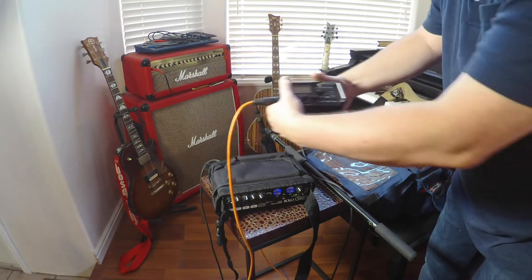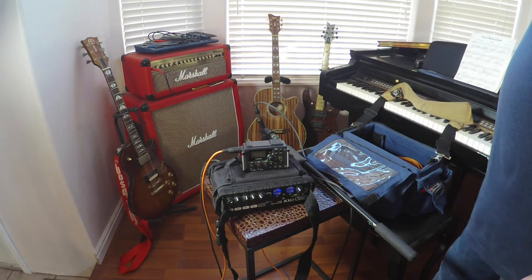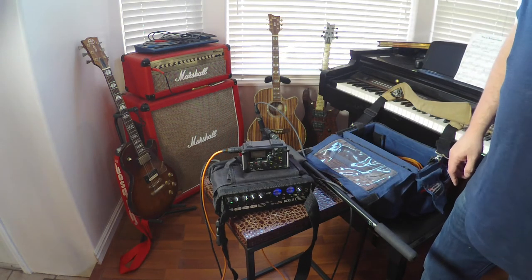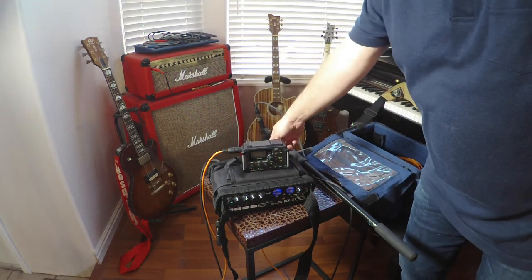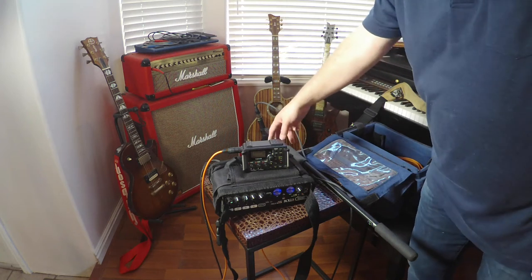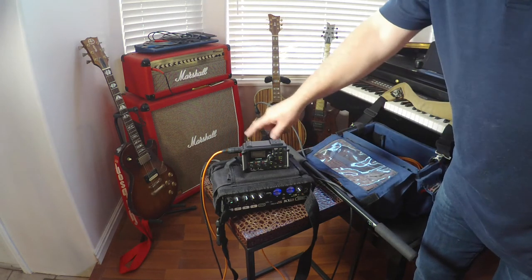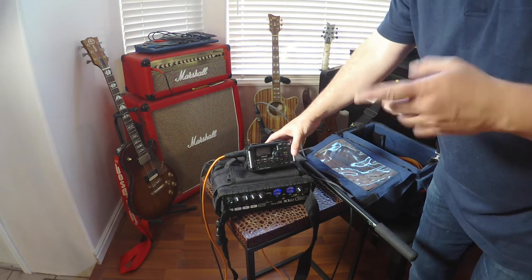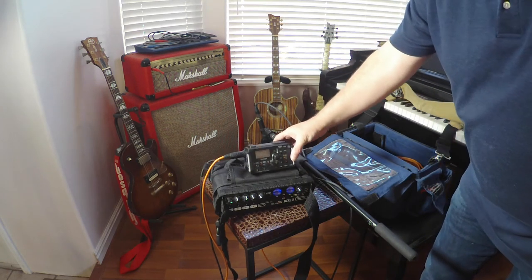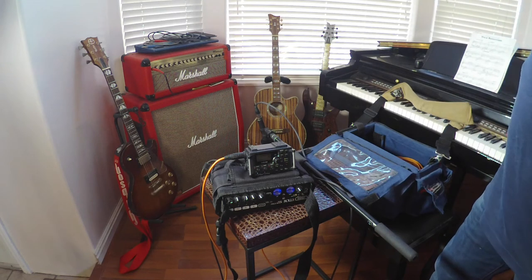That's the basic setup — a simple but very powerful audio setup. You can get really good audio with it. You have up to four inputs and up to two controllable outputs from the mixer, and two XLR inputs on the recorder. You usually don't have more than one or two microphones going at a time on set, and they're mono, so there you go.